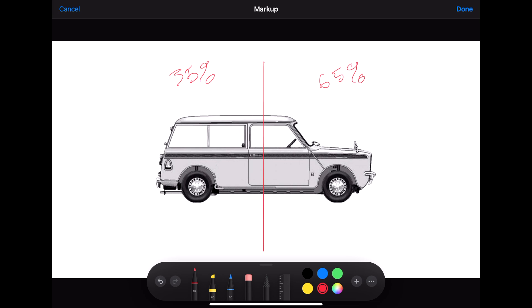Actually most Minis are very close to this, give or take a couple of percentages. The total weight of the car is 686 kilos, which means we have a bias of 445 kilos on the front and roughly 241 kilos on the rear. That's before we apply the additional weight of a battery. At the moment the estimations are that we're going to add around about 30 kilos because of the battery.